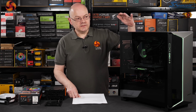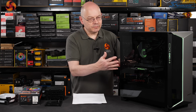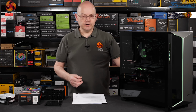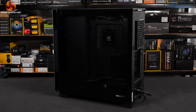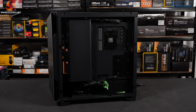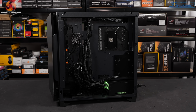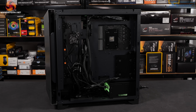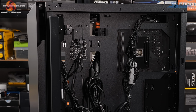The top of the case is ventilated and filtered. That works reasonably well. We've got glass on both sides. Now the glass on this side, on the back panel, it's led me to install an ARGB power supply, so there is actually some function to the glass, but nonetheless it makes cable management awkward. There is that cable management panel that goes over all the cables. However, the EPS connector from the SuperFlower Leadex 3 power supply, it was really tight going inside that cable management cover. Similarly, the cable management holes, not a grommet in sight. I don't know why not. It seems like a complete oversight.